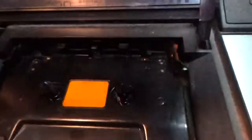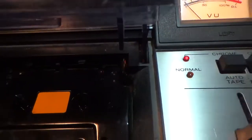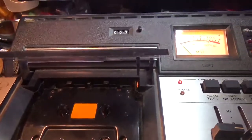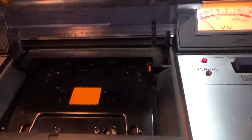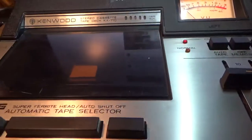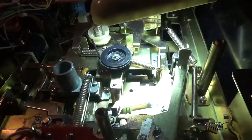See the pinch roller, but the take-up spool is not rotating. But it rewinds and fast forwards — that's all I'm getting out of it. So I need that one belt which I can't access. Somewhat working, but still not quite right.